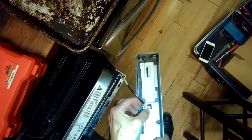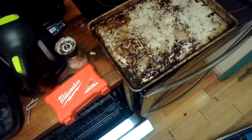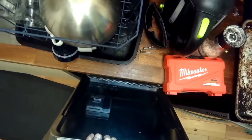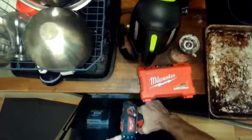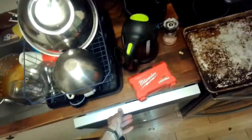Put this little modular connector back onto the control panel that feeds information into the computer as to which cycle you want and when you want to start it. This goes in pretty easily — just put it back on, then add those longer screws to hold it in. You can certainly do this with just a hand Phillips screwdriver; the power ones are nice, it just makes it go faster. We've got all the parts back in, everything's tight — close the door.